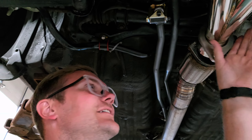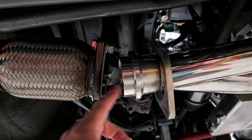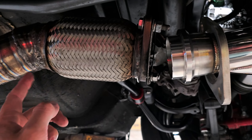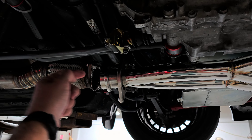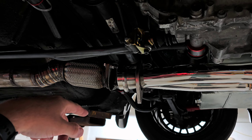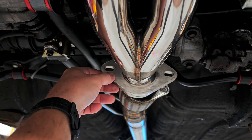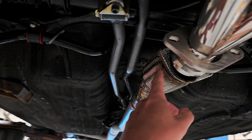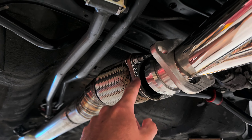We've got a little bit of distance here. We're at the wrong angle, so more than likely we're going to have to cut the pipe back, move the flex pipe back a ways, and then straighten it out and get it at the right angle. You can see the exhaust is going straight while the downpipe was coming down from the top. As far as everything lining up laterally, it's actually pretty close — we don't have to do much turning. It's going to be more about changing the angle and the length, and then we'll use a 2.5-to-3-inch adapter flange to step up to the 3-inch exhaust.